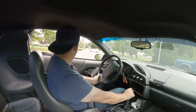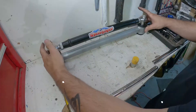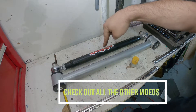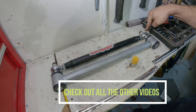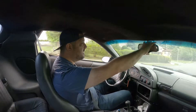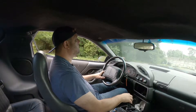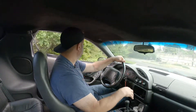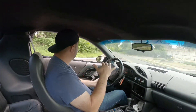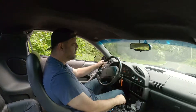We swapped over the rear control arms from the Stein Jaeger fully double adjustable heim joint to a non-adjustable poly. Definitely a smoother ride, but the Stein Jaeger definitely has more control over the axle. So you do compromise a little bit with the polyurethane, but the NVH is really low — you don't get any of that metal-on-metal feedback I can get with the heim joints.